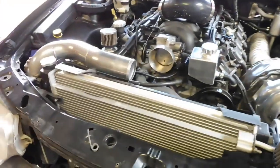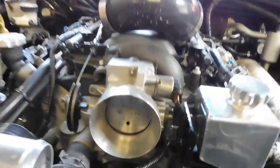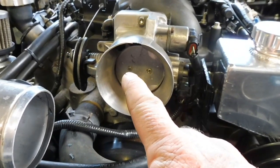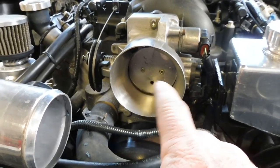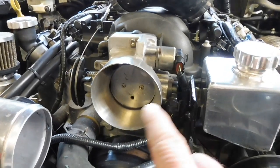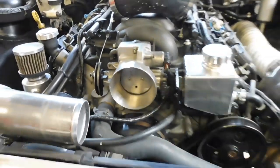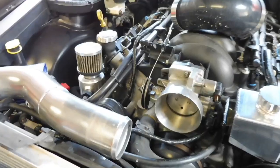Now I'm up in the engine bay, obviously I've got the intake off. For the two most important bolts on your whole car, these two right here. If these two little bolts vibrate out, which has been known to happen, especially on those cheap Chinese throttle bodies, I always keep the standard Holden ones because they're just so much better quality. So I even still check these. They are a T15H bit. They were tight, double checked them, so I got that off to check.